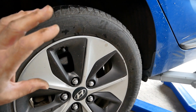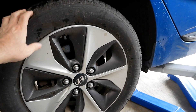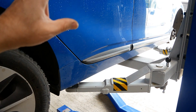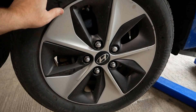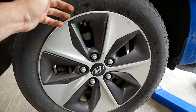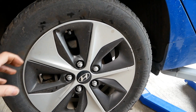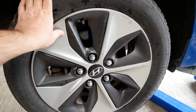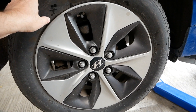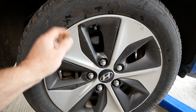You'll often find the noise is worse on the rear wheels, which is what we're looking at here. The back wheels don't get much braking: when you do apply the brakes, the majority of braking force goes to the front wheels because that's where the weight of the car is. The rear brakes do very little and consequently will always be in worse condition — more corroded and noisier. When you're reversing in the morning, the rear brakes are where most of the noise comes from. It sounds quite horrible, but again it's completely normal — a lot of it is because the wheels are turning in the opposite direction, freeing a load of debris from the pads.